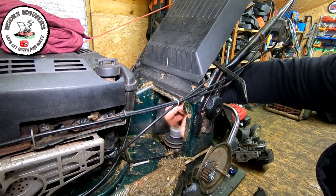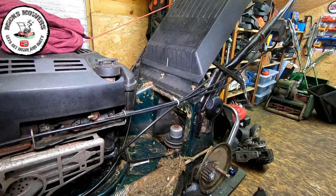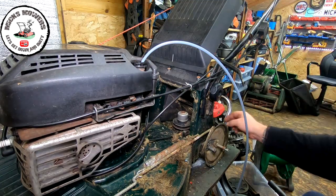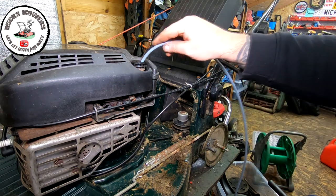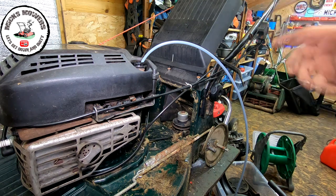So what I'm gonna do is I'm gonna take this gearbox out, take the gears off, and see if I've got a spare axle to fit it or something similar, and then we'll go from there. So take the circlip out, remove the gears, both sides is the first step. Right, so what I'm doing now, I've taken the gear cogs off and all the gearing is complete everywhere it should be. It's no problem. I've taken the oil out of this machine because once I take the other cogs off the other side, this machine will then be tipped over onto its tummy.